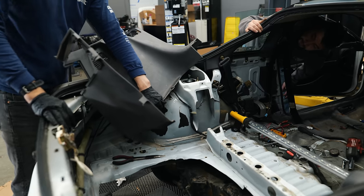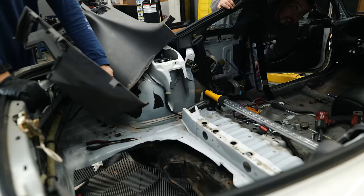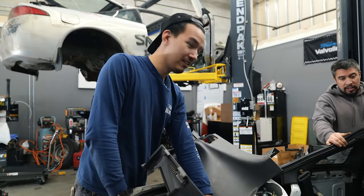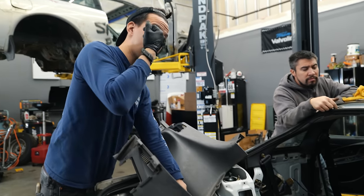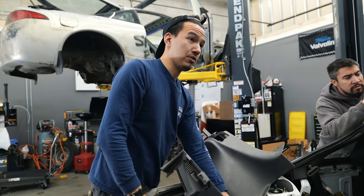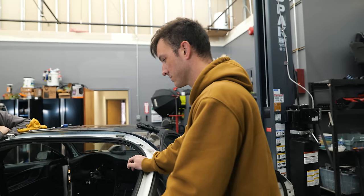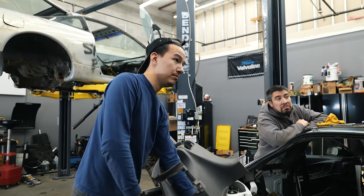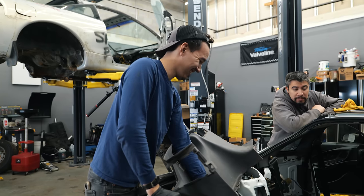Nothing surprises me. What are we looking at here? Why are you trying to look for purpose in how someone modified this? Are we unmodifying it? Yeah, we just need to put something here. We can cut it out of that car or just use sheet metal or whatever, but that is a structural hazard. And it's the same on that side. I think they were trying to run a cage maybe, but only got as far as mutilating the chassis before they gave up.